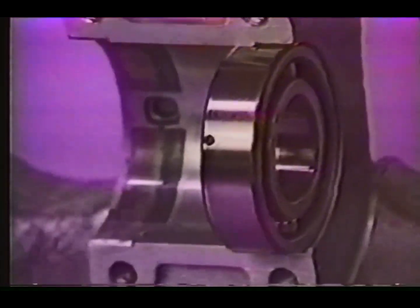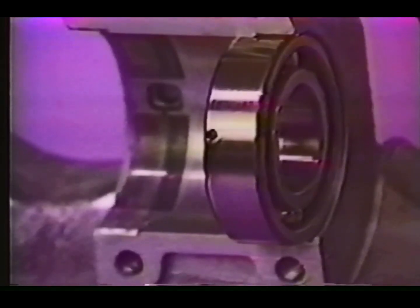Polaris has different tolerance bearings. We call them C3 or C4 in the Polaris engine. They do have different crush tolerances. If you run into a crankcase that has journals that look like this, the crankcase should be replaced.